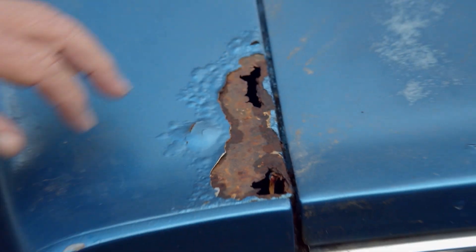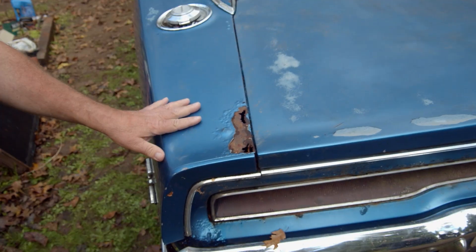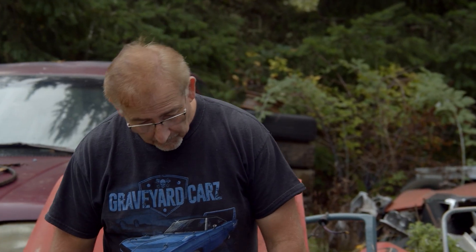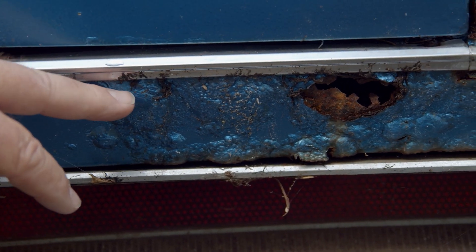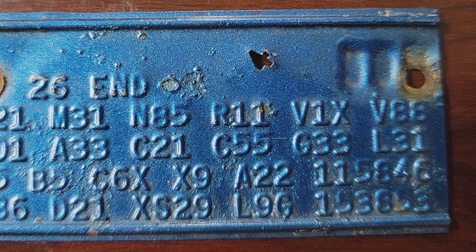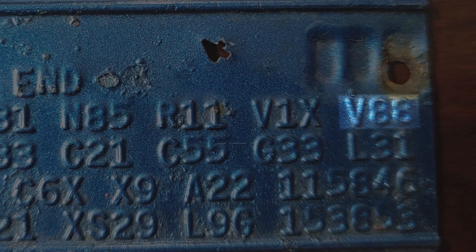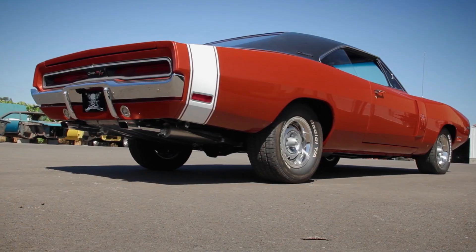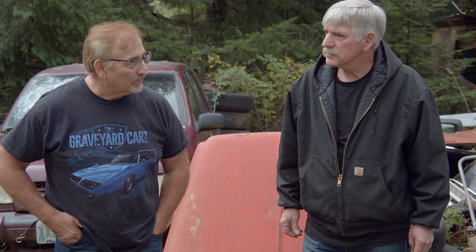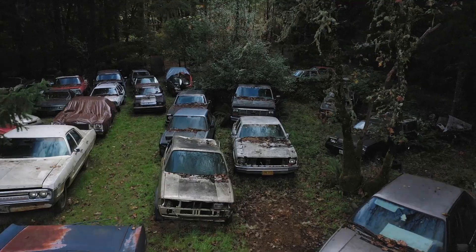There's a little bit of rust — depends how it looks when it comes out of the dipper. Sometimes you can just put a small piece in, sometimes you've got to put the quarter on. AMD quarters are good if you put them on all the way up and pre-fit everything properly. The rear body panel has a little crusty material — that's okay. There are two disappointing things on this car: the original engine is gone, which does affect the end value, and it's not coded for a stripe — it's actually a stripe delete, so it didn't get the cool bumblebee stripe. Instead it has the RT badges on each quarter panel. Brian got this car from Dan Perkins, who also sold Mark a burnt orange black-top '70 Charger.